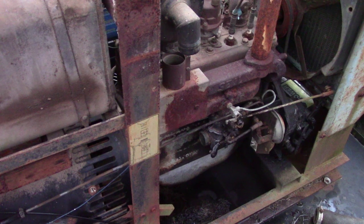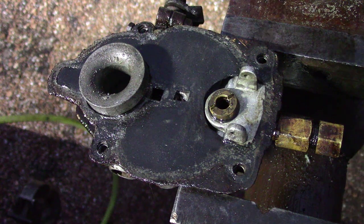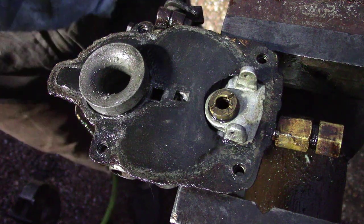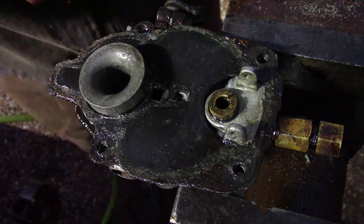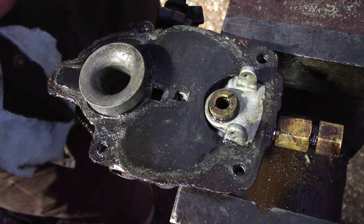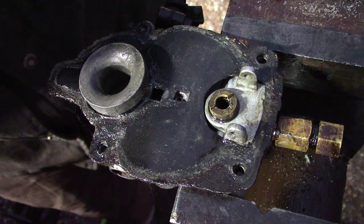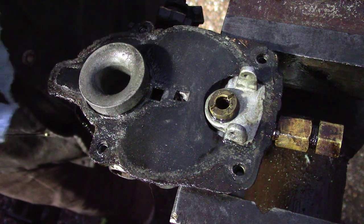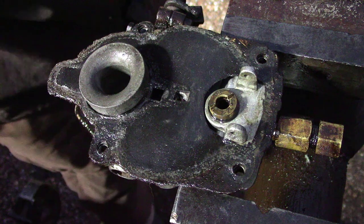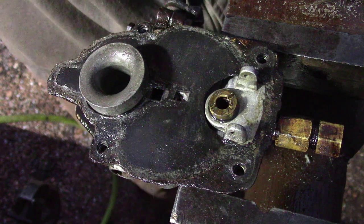I thought it would be a lot easier to get it going, but apparently not. Heck, I'll take that carburetor off. Give me a few minutes. Okay, so we found all kinds of questionable crap in the carburetor here. Clean the floats back up. Clean this intake off here. All right, so the needle seat had quite a bit of schmoo on it and some kind of good stuff. Shoot a little bit of diesel fuel on it. Put this little turd back in here.